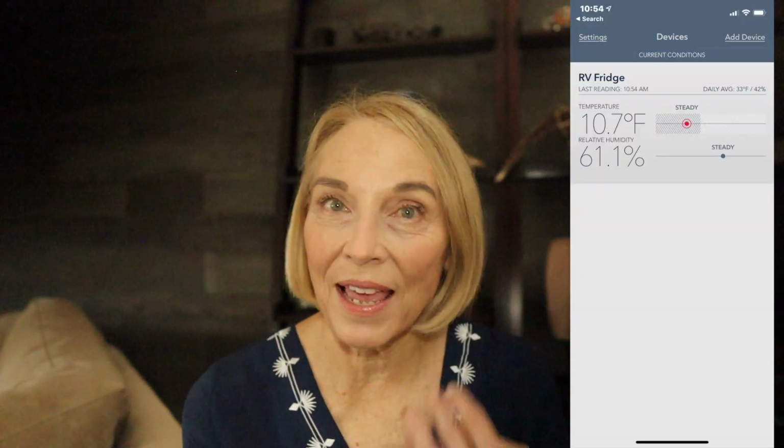At the coldest setting, the refrigerator goes to about 31 and the freezer to about 10. At the next notch down, it holds between 37 and 40, and the freezer is at about 15 or 16. So that's probably as cold as the freezer is going to get. But I also want to say that's without any food in it. The refrigerator is empty, and so when it has food in it, it will probably be even more consistent in holding temperature.